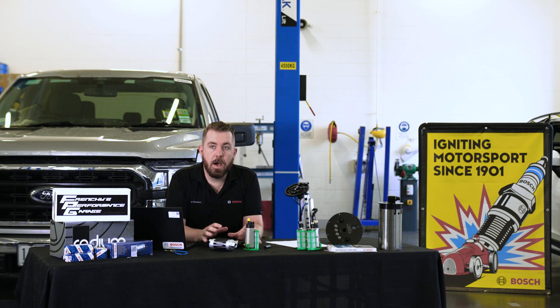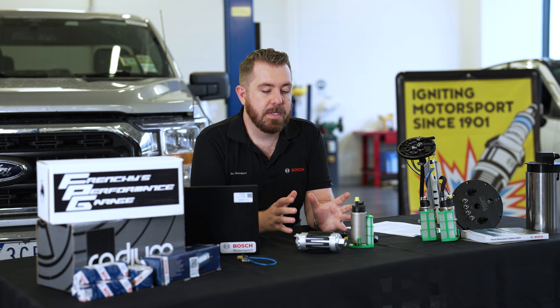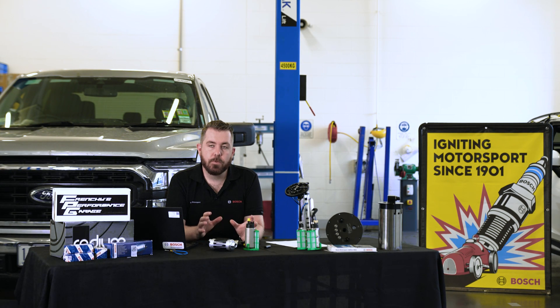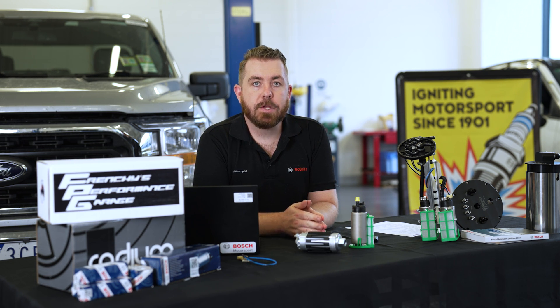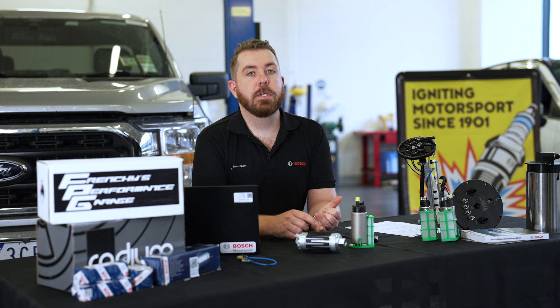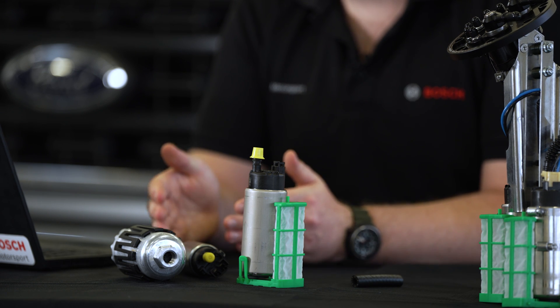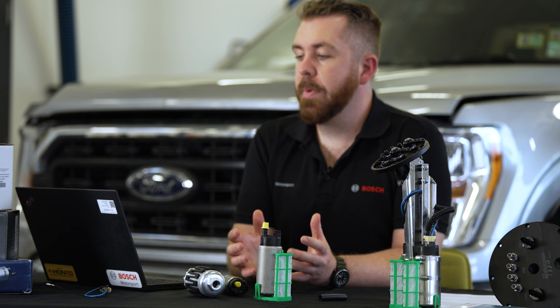Fuel pumps have very precision engineered internals which can be quite sensitive to vibration over time, especially if you're running ethanol fuel through them. Your fuel pump is actually one of the hardest working electrical devices in your car, and if you're upgrading from a smaller standard pump to something bigger, you need to ensure that the amp and voltage draw from the pump doesn't overwhelm other electrical components. Bosch Motorsport supplies data sheets for all its fuel pumps, allowing you to evaluate if other elements of your electrical system relating to the fuel pump are up to the task. A high flow fuel pump without sufficient gauge wiring can actually overheat and melt electrical connectors and wires, which is obviously a very dangerous situation. You should also ensure that your battery and alternator are up to the task of delivering the required amps — if they're not, your fuel pump won't be able to supply the fuel you require.